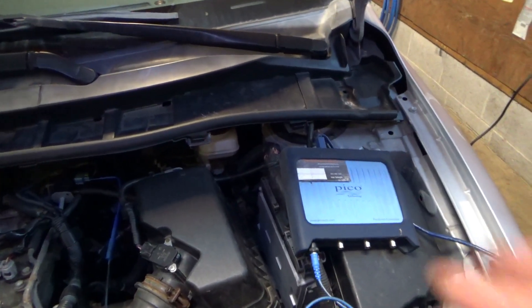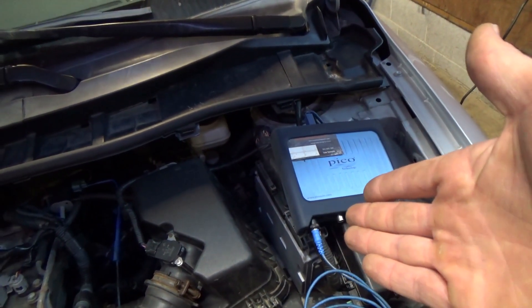Is that good enough? The only way to check is to reinstall the original engine computer. As the owner said, with that one the purge solenoid was getting just full open, which maybe this car needs in order to do a successful check. Something is not adding up here.